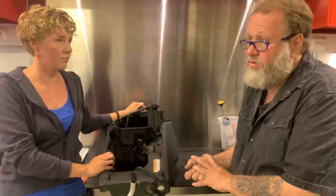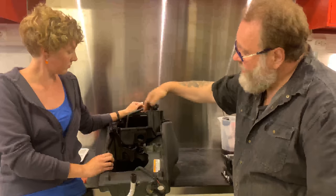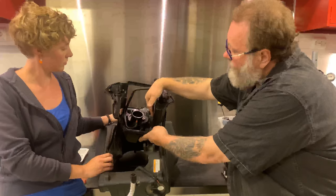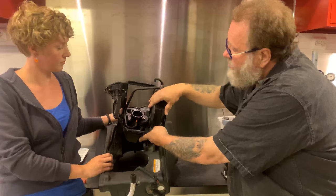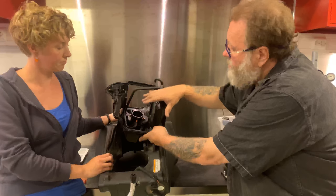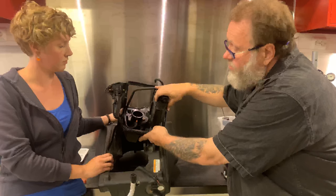The airstream around the throttle bodies is as unrestricted as possible. Originally, the throttle bodies have a wall on one side, and that is also something where we expect to see better numbers on the dyno. So it is more volume, less restriction, and less weight.